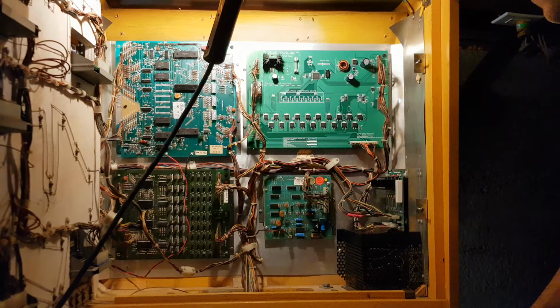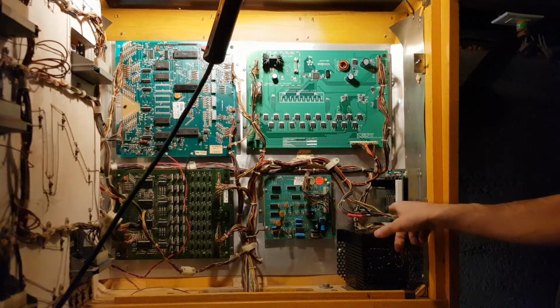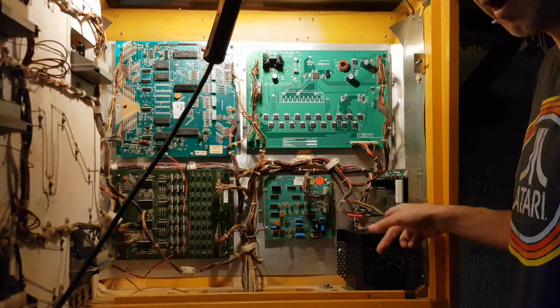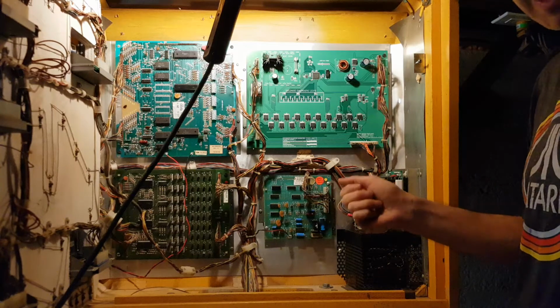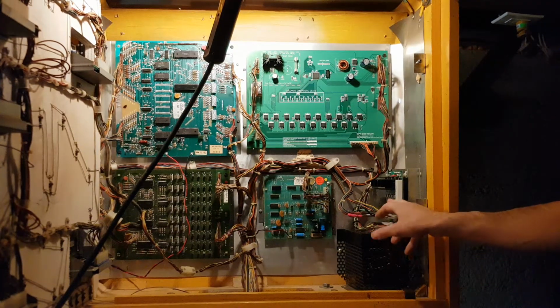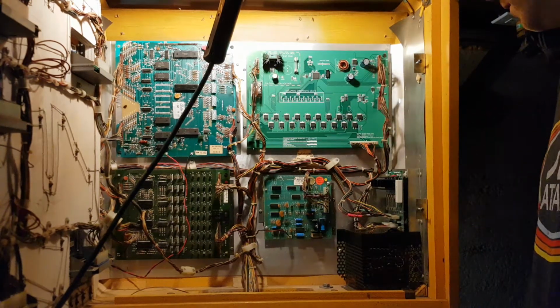That's really about it. Double and triple check your power supply if you're going to check anything. That's the only one that can typically get screwed up if you're not paying attention, or if they're not keyed. These connectors get burnt, they get replaced, people don't key them, and you can put them in upside down, and you don't want to do that. That's very bad. So just triple check the power supply. Everything else is pretty much foolproof.